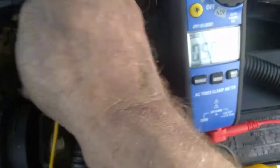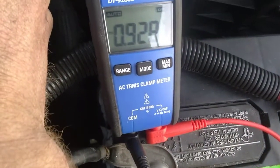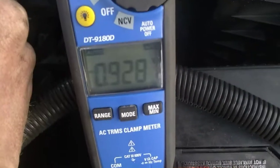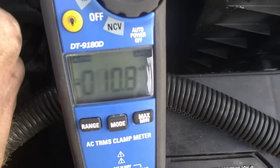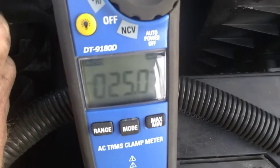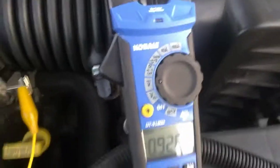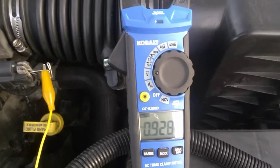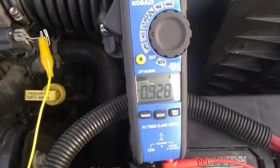Go ahead and plug it in. Move back to the middle wire, and now it's reading a little less than a volt. That tells me that's my signal wire, and that also tells me that the top pin is my ground, and that my wiring integrity is good. It also tells me that my sensor is good so far. You want to read about a volt — 1.2 volts or 0.9 volts.